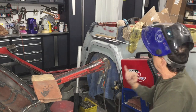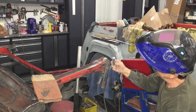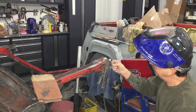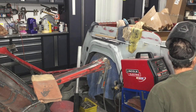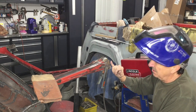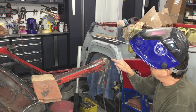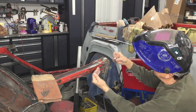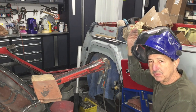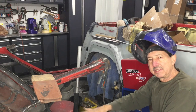There's a big gap here. There's a little trim piece that goes right here and it's too far away, so when the manufacturer created it they just twisted this piece to cover it up, so then it doesn't line up with the trim that's on the door. Not only is it too far upwards leaving a gap, but it's also too far inwards leaving a gap here, and moisture just goes right into that area. There's a drain hole right next to this in the body where it goes right down into the front panel next to the door and eventually ends up in the rocker panel.